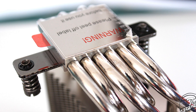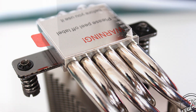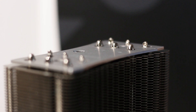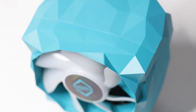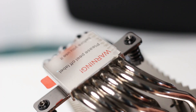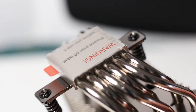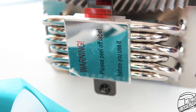While the nickel-plated surface of the heatpipes is done very well, the same cannot be said for the heatpipe endings, which are not symmetrical at all. However, the plastic shroud will cover them up so we can give this one a pass. The base plate of this CPU cooler is made from solid nickel-plated copper, has a very smooth surface, and the build quality is on par with the big coolers from the main manufacturers.